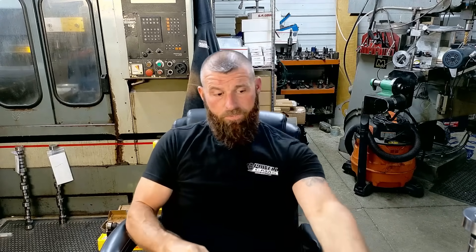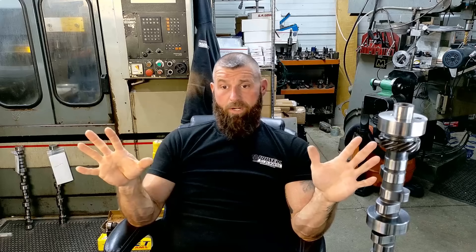That's just crazy stuff. If anybody knows the answer on this small base circle ford stuff, I would love to know, because I think it's an old wives' tale that's just been perpetuated. But I could be wrong. Just be aware of that kind of nonsense going on. When ordering a cam, I would want to specify whether I'm getting a steel or a cast core, and if I'm getting a steel core, what grade steel is it — because all of that matters.